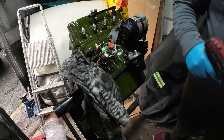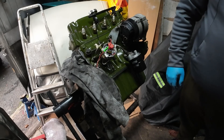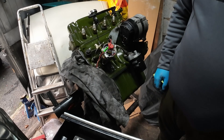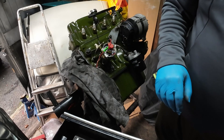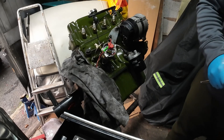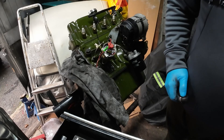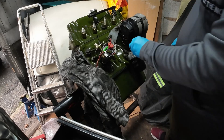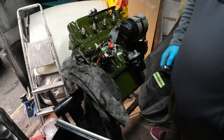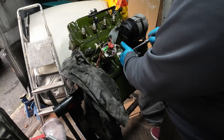There are no torque settings for these because the blocks are slightly different and you can't torque them up to the same spec as the original oil filter — it's in an aluminium housing. So I'm just going to pinch them up and make sure they're nice and tight, done up to two clicks of the wrist as they say.